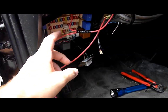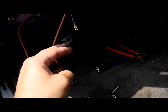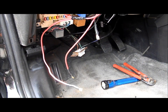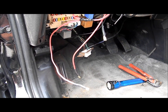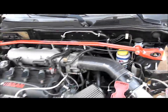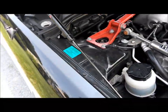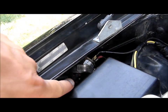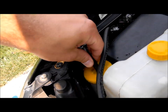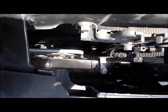This is going to be the main power source — I've already tied into that. It should come on and off with the ignition. This is our ground; it grounds right to the body. And this is the hot leg that goes out to the washer pump when you switch the switch on. We finished up wiring inside the car. The new wire runs all the way over by the throttle body, underneath the intake plenum, over on the right side of the car to our universal washer pump. Our hose feeds to the intercooler right here, and the other tube is supplied through the washer reservoir, pulling fluid from there down to the pump.